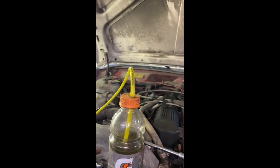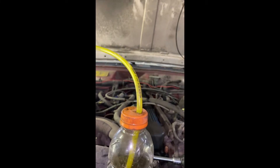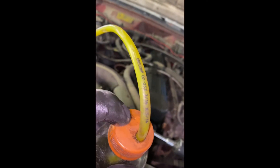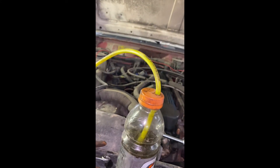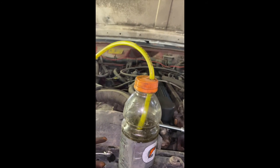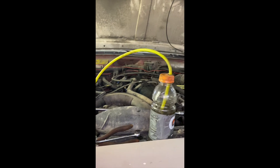Some of the simplest things I have for brake bleeding: a Gatorade bottle with a line all the way down to the bottom. Clear bottles work best; clear lines work best because you can check for bubbles. Because the JK has such a large bleeder nipple, you have to have a little adapter on it when you use this kind of line. One of the main things is make sure you have a bleeder or vent at the top to let the air out — bubbles go in, they go down to the bottom, and it can only suck fluid back in, so there's no way of getting a bubble back into your system. Make sure your loop is below your reservoir so it always keeps a head of fluid above the line where you're bleeding. Probably should keep brake fluid off your paint job — it will eat through paint.